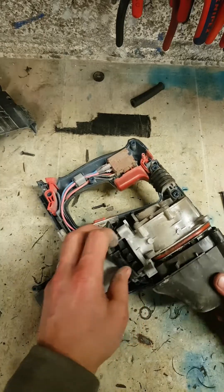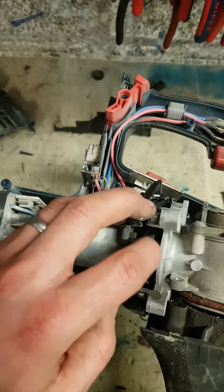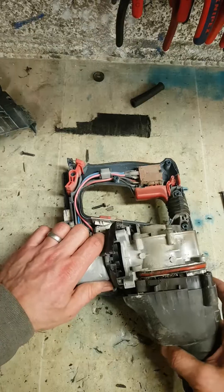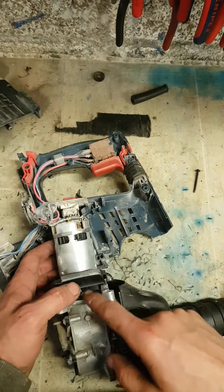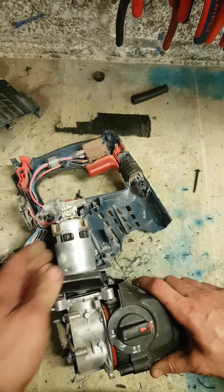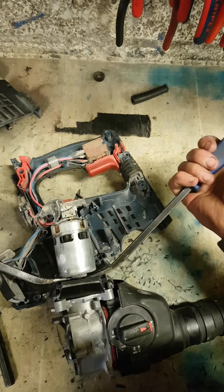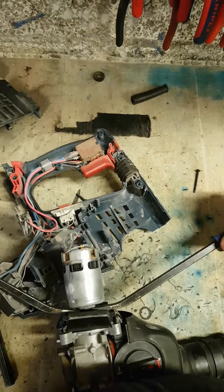Something's just not right there. That fan is destroyed. That air deflector has burnt up. This motor is only on a shaft with a hex end that locates onto the fan. But from day one these were a bloody problem — to change the motor you have to pull them out, and they just rust and seize onto the shaft.